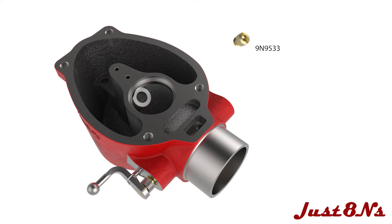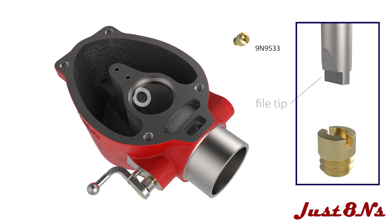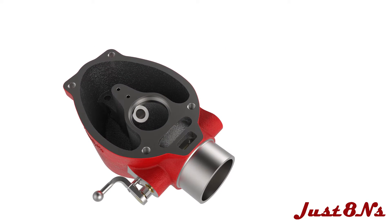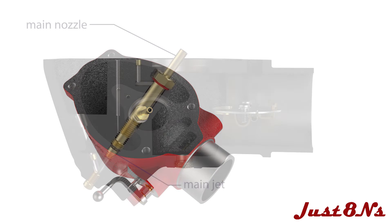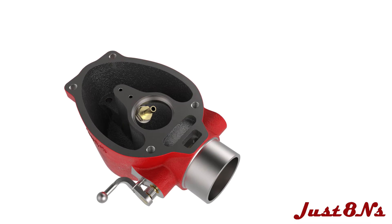The main jet is installed in a hole located at the bottom of the main fuel passage. Insert the main jet in the hole and tighten, being careful not to over-tighten and damage the screw slot. It's advisable to file down a flat head screwdriver so as to fit snugly in the main jet's screw slot — this prevents damage to the slot, allowing for easier removal when necessary. Place a gasket on the main nozzle and install the nozzle in the main fuel passage. Screw in by hand and then snug it up with the socket wrench. The relative locations of the main jet and nozzle are as shown in this cutaway.